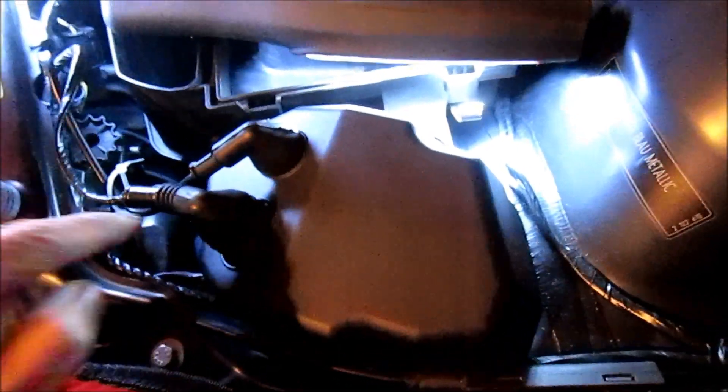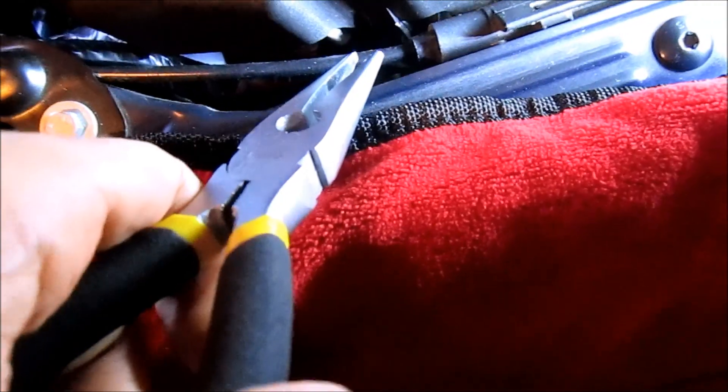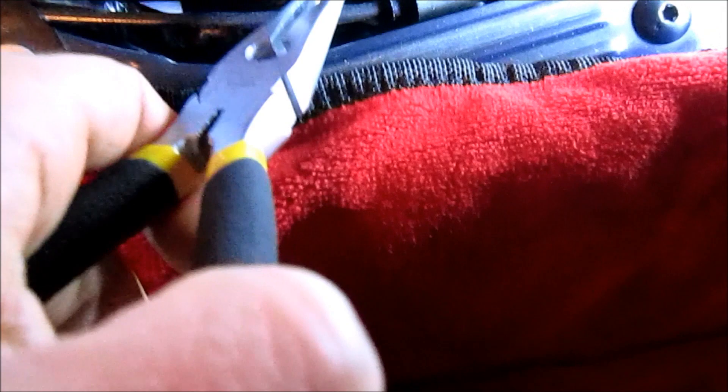For the xenon ballast, we're going to pull these off carefully and also remove that. To disconnect this, basically you're going to squeeze the two edges together — squeeze it and it'll just pop right up. There's also one over there. To remove the last part of the housing, use a set of needle-nose pliers and gently press the piece together, then pull upwards and it should pop right up.